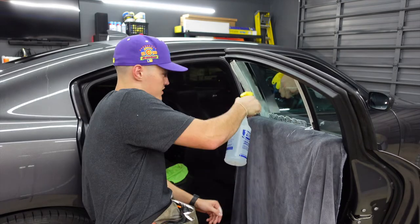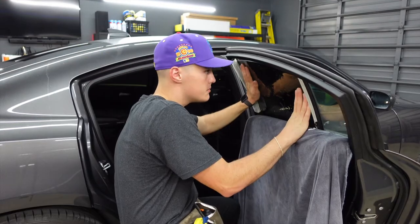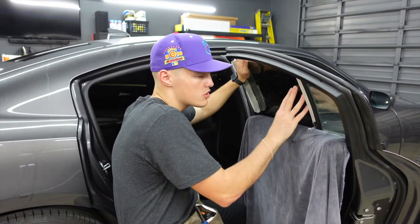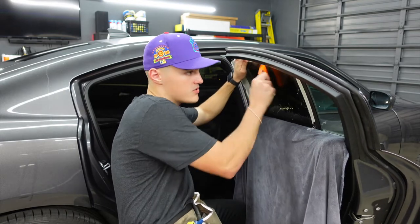I get questions about what you can do to prevent contamination from getting inside your window tint — that's one of the big things. Spray down your edges: bottom edge, side edges, mist the middle. Now grab your film and apply it to the window. It's also an important time to mention that we did take the bottom seals out, which makes it easier to apply the film using the bottom loading technique rather than the two-stage method.